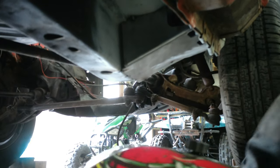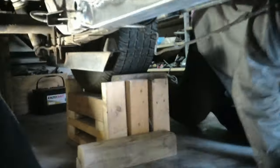That's how that torque box goes. Let's work our way to the other side. I also fully welded in the bottom of the main frame subframe rails — they're done. I've got to clean up the welds a little bit on the bottom. Welding upside down is not the easiest thing, but they came out all right. It was a lot easier on a brand new floor to weld to. I got good penetration and the car was solid. Hopefully you never have to cut them off because at this point it looks like you'd pretty much have to do the whole floor.